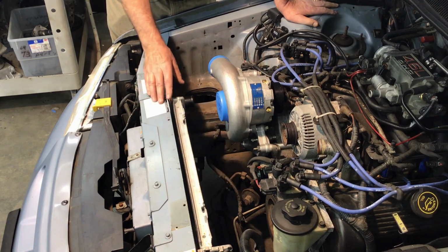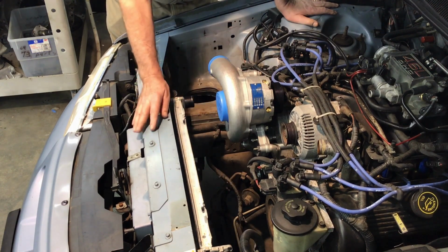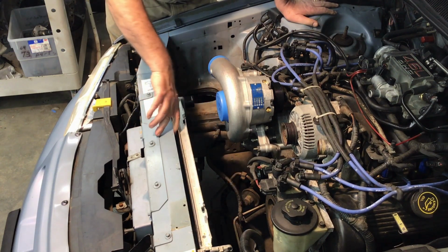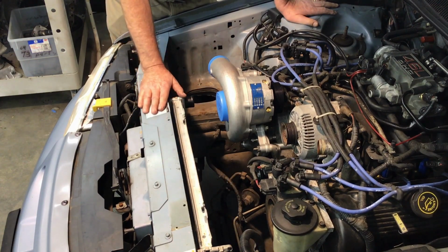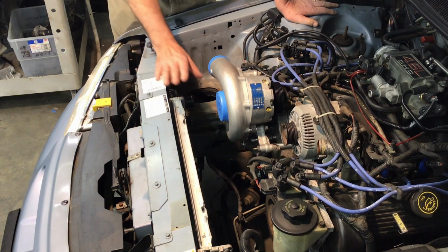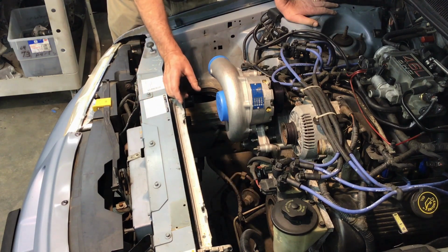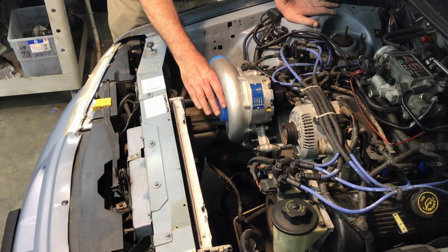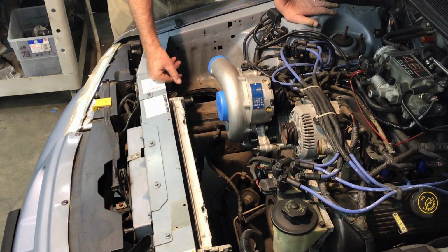So in other words, what I'm looking to do, this part of the radiator right here needs to be under this bulkhead about 1/2 inch here. There's a rolled piece of sheet metal right there, and this part needs to be right parallel with that rolled piece. So going down about 1.5 inches or so, going in about 2 inches, that's going to put the radiator further forward, get it out of the way, and the fan shroud, which is also going to stick out, I believe, by being lower, that will clear that tube, including that hose connection on the bottom for the bypass.